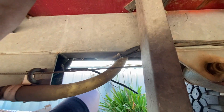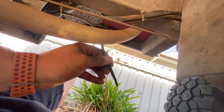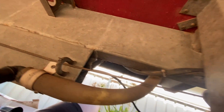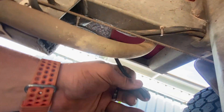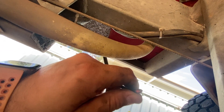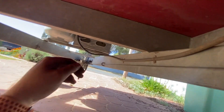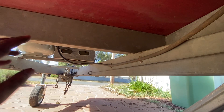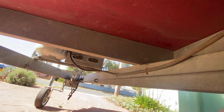I've just left this little tail of cable just off the end here going into the drawbar. The reason I've done that is just to use this as a draw wire. So what I'm going to do is just attach the new cable to the end of this one and use the other end at the end of the drawbar just to pull it all the way through — just to make life a hell of a lot easier to be able to pull that cable straight through the drawbar to the other end and attach your Anderson plug up there.